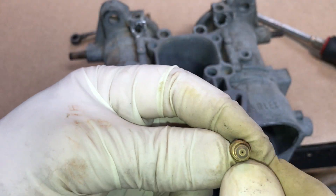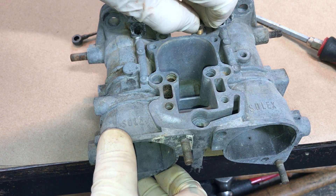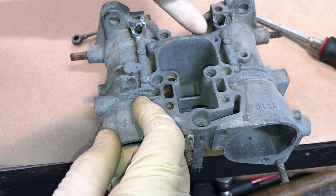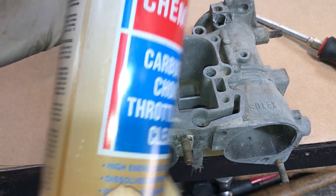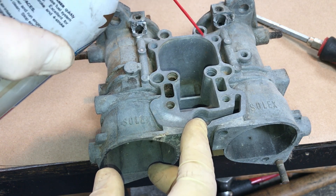Here's the G55 — it's got a tiny hole right there, all it does is screw down in there and snug down. If this is clogged or the ports in here are clogged, you're not going to have an idle. If you have any trouble, take your B12 and spray the heck out of all these passageways.